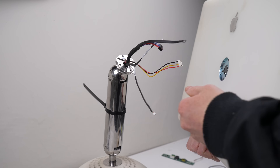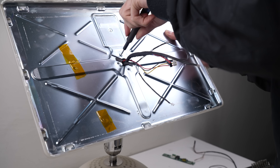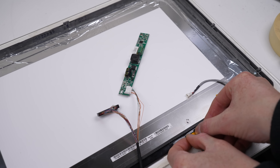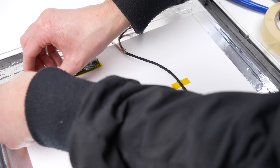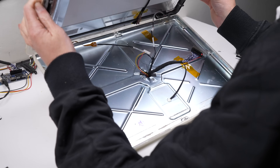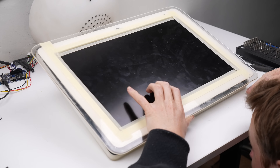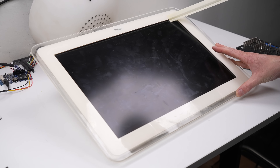While that's drying, I'll get the arm reattached to the base. Then the display's housing can be reinstalled by first feeding the new cabling through. Now it's just the case of connecting and fastening the display cable and backlight control board to the back of the screen before it's attached onto the iMac. Once everything is confirmed working, I can remove the tape from the front and slide the screen into place.